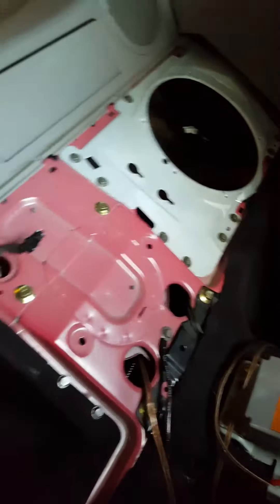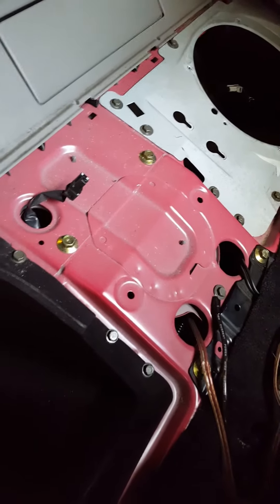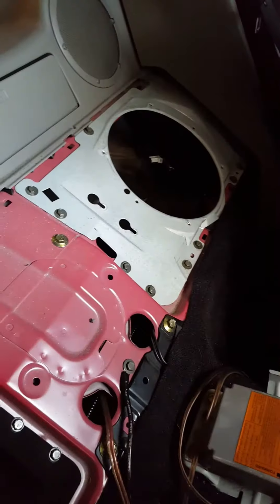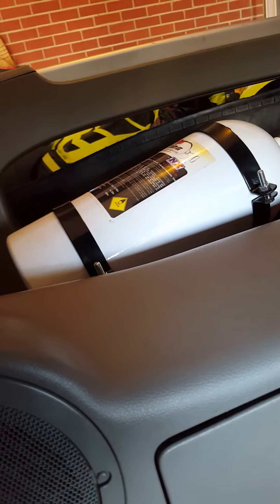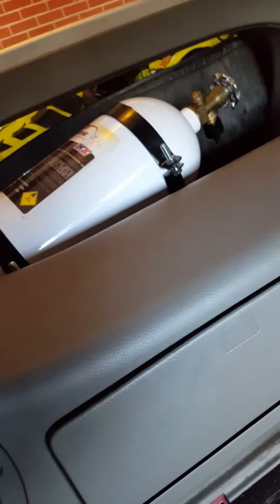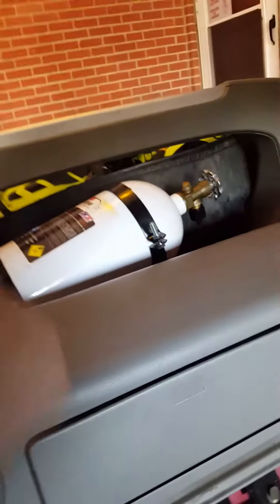Flipping this up gives access to the fuel tank. There's one over there — I'm not sure which side the fuel pump is on, or this thing might have two fuel pumps. You've got access to the fuel tank on both sides. I had to take all this stuff out just so I can get to the holes I drilled way back there for my nitrous brackets. I ran four bolts, 13-millimeter head, with washers and lock washers on top, and nuts and washers on the bottom — so far it's not going anywhere.